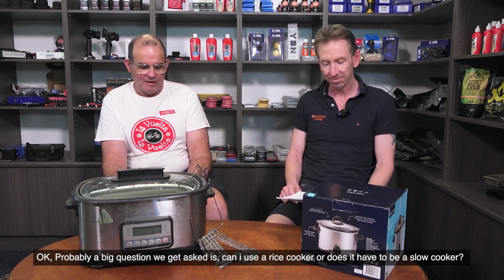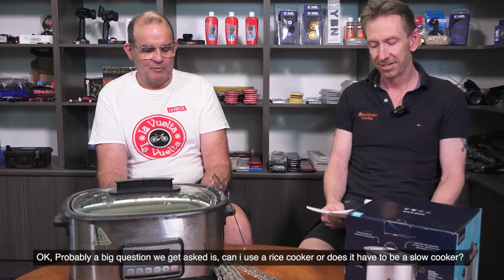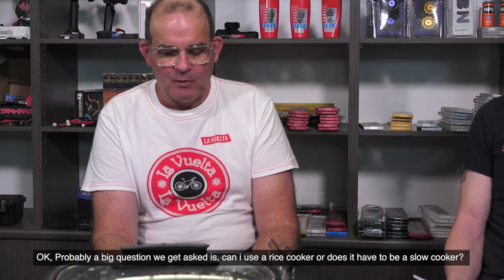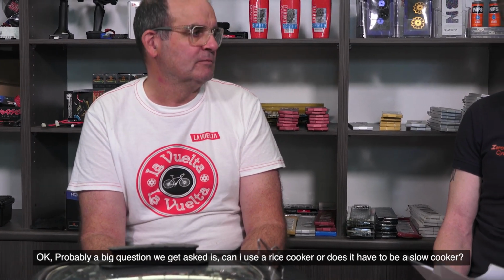Okay. Probably a big question that we get asked is, can I use a rice cooker, or does it have to be a slow cooker? It must be a slow cooker. Rice cookers are tempting because they're cheap and they're a great size for a bag of wax, but paraffin likes to be heated slowly as well as not get too hot. Otherwise it breaks down the long chain molecules of the paraffin and kills its lubricity.